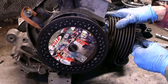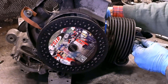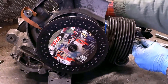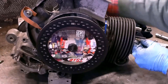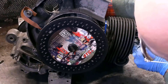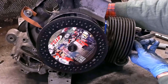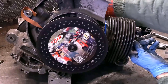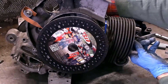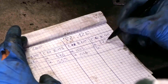We have mounted the same cylinder on the other carter, on which a shaft has been placed in stroke 60 with connecting rod 110. The goniometer has been positioned on zero. Let's now measure the exhaust — 173 degrees. Now here we are at the transfer, goniometer on zero. 114 degrees. Taking note: 173 for the exhaust and 114 for the transfer.